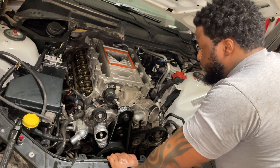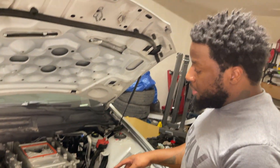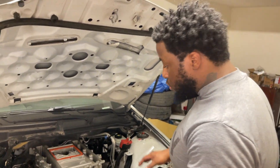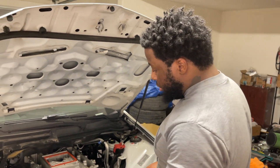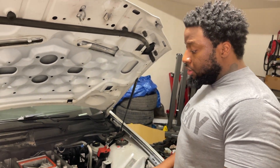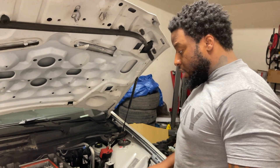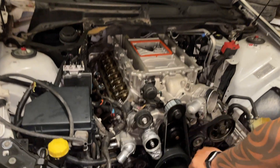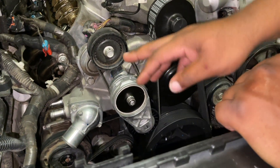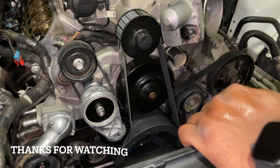This kicked my ass when it shouldn't have. Words of advice — I don't have my spark plugs on yet, so it makes it way easier when you're turning the crank and rolling the belt onto it. I recommend this kit. If you set everything up perfectly, make sure you have everything where it's supposed to go — your coolant crossovers, your wiring, everything — because to take this off you have to remove the idler and roll the belt off, you have to do everything backwards, and it's a pain in the ass. But it's well worth the money. It worked for miles. I beat on my GTO — people in Phoenix know I race damn near every weekend. I had no problems. It's $375, best bang for your buck. It looks good and it takes up very minimal space. Some guys have the OEM tension and stuff here, they have to change the idler off the water pump. We have none of that going on here — nothing contacts, everything has enough clearance, and it looks good. 8-Rib kit, LSX Concepts — I highly recommend it. Thank you.